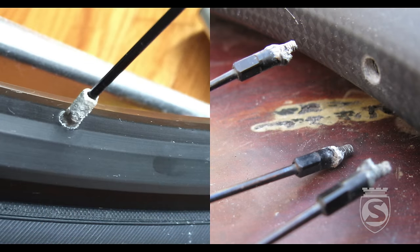You've got stainless next to aluminum, which is a galvanic risk. You often have aluminum nipples in a carbon rim, which is a big galvanic risk. Sometimes it's brass, which is a little better — but in the presence of sweat, which has salt and trace amounts of ammonia, you have a massive acceleration of corrosion, mostly galvanic. Some of it can just be straight corrosion of the aluminum, depending on the ammonia in your sweat. There are pictures showing carbon or aluminum rims just cracking and failing from the material damage caused by sweat, and spoke nipples on the bottom half of the wheel turning to dust.